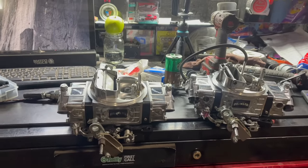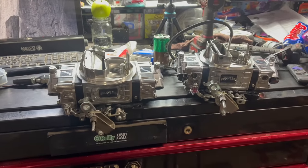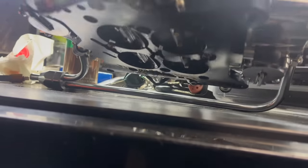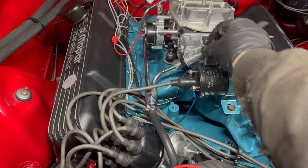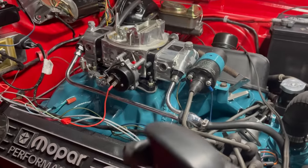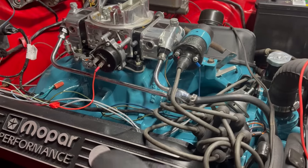For science, let's see what's what. As far as I know, this one is almost brand new — it's never actually been on an engine. It's got the throttle adapter for the Chrysler, just like the one I just pulled off. Are blown power valves still a thing? Dual-feed Holley leaks — it's like the name of the game, from the washers, from the flare fittings, from the needle adjustment points, from the bowl screws, everywhere. So what you want to do with no ignition: crank your engine or power up your electric fuel pump and fill the bowls. Watch for leaks. A whole lot easier to do that now, safely, than with the engine fired up.